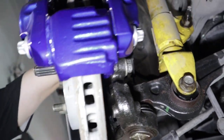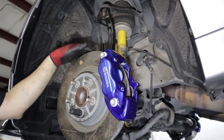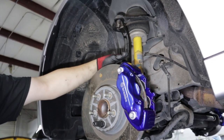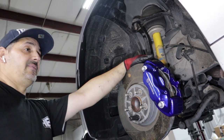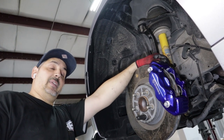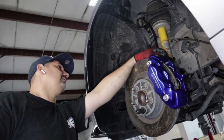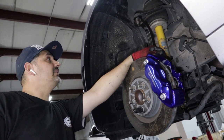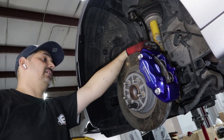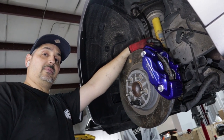But there you have it — the majority of it was the upper control arm swap. I wanted everybody to see because everybody's always asking how you swap those out. People just think you can just put your Brembos on there, but you can't. Simply because the A-arm comes with bolts for the 5.7 and the V6 is bolted onto the A-arm; on this one, the actual bolts are bolted onto the Brembo. Comment below if you got any questions, anything I didn't cover, and I'll get back to you. You can hit us up on Instagram at Modiflex, at Randall Modiflex, at Jose underscore Modiflex. See you on the next one — like, comment, subscribe. Peace.